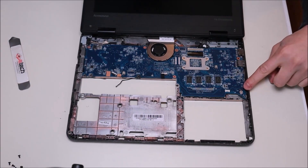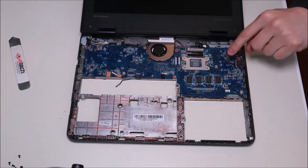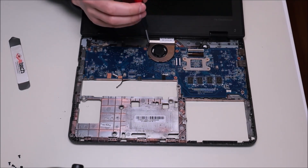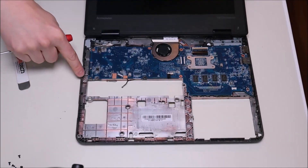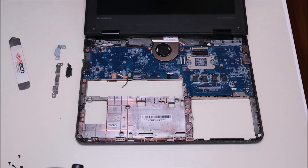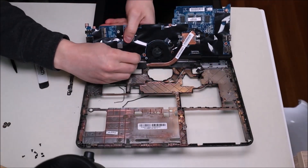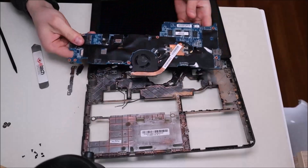To get the motherboard out, there's a screw here — you can see the little white triangle pointing toward the motherboard screw, which is a nice aid when reinstalling it. There's another screw in the fan, which is attached to the motherboard, and one more screw over by the USB and power jack. That shield comes up. Now you can grab it and lift up on the motherboard. To get the motherboard free, pull on the port connector — that comes right up. Same with the LCD cable — just pull — and then the power button port unplugs by pulling out.